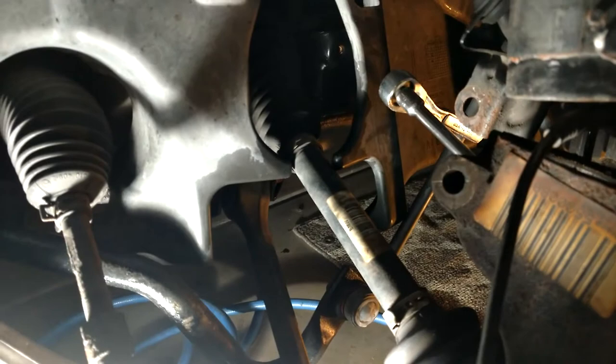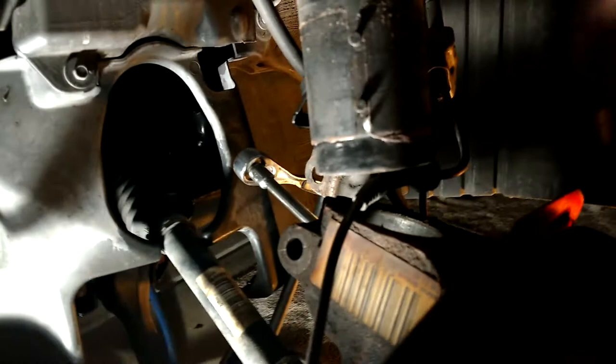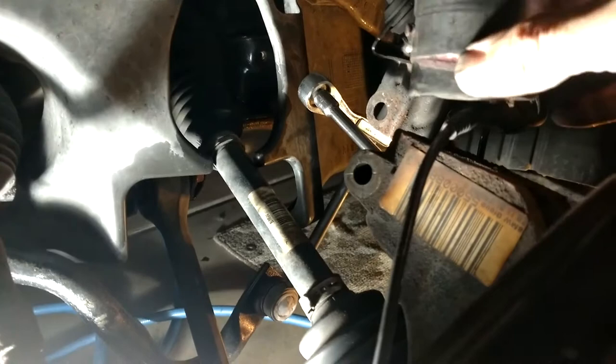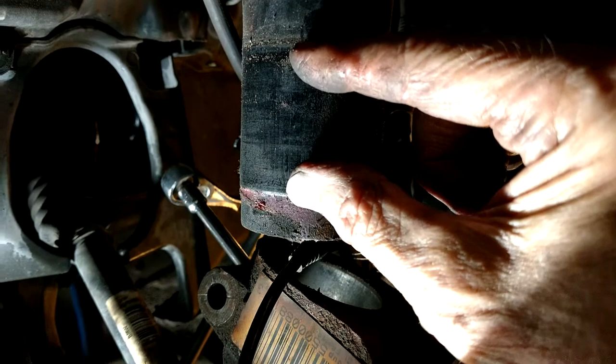The whole thing fell out nicely and it seems to have given me quite a bit of movement on the outside of the axle. Note that there are lining tabs here that go into the slot in the back whenever you're reassembling it. Also handy to note the line of dirt where the pinch clamp was originally installed so you can get it back at the same height - always a good idea, saves you some alignment issues down the line.